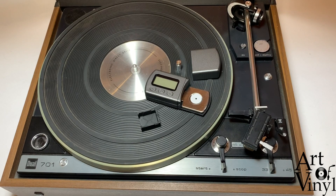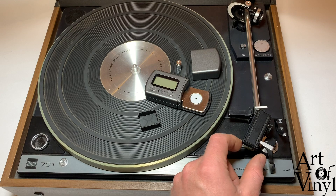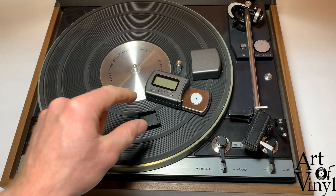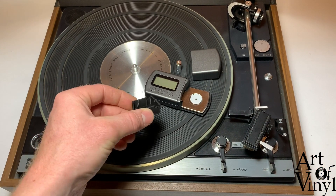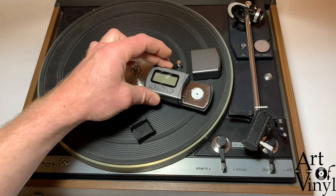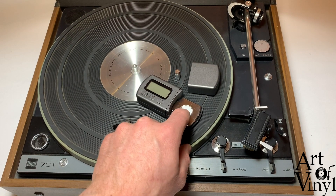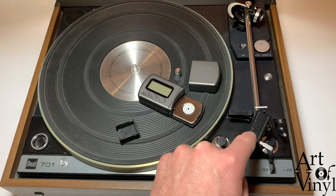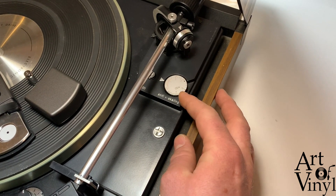This is a relatively simple procedure and without too much technical knowledge you can do it yourself, but you must always be very careful because the cartridge and the stylus are the most sensitive parts of the record player. We will be looking at three different things: first, adjusting the positioning of the cartridge inside the head shell using an alignment tool; then the tracking force using a tracking force scale with a plastic piece and black dot so you won't damage the stylus tip; and next, the anti-skating.